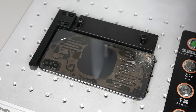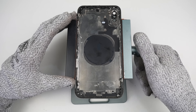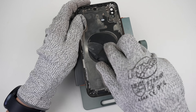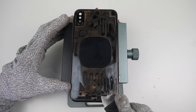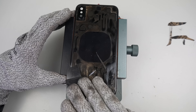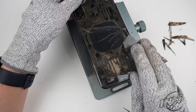With the two passes completed it's time to separate the glass. Despite using the high-powered laser we'll still need to pry it away. I find it's best to start on the inside around the wireless charging area, using my Jimmy tool to break loose some of the glue. Back on the outside I can continue flaking away the glass shards — the more cracks there are in the glass the harder it will be to remove. The most difficult area is around the camera lens; the glass is seated under the camera frame and the back glass has to be smashed in order for it to come out.